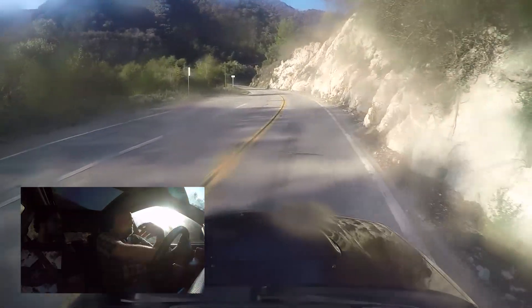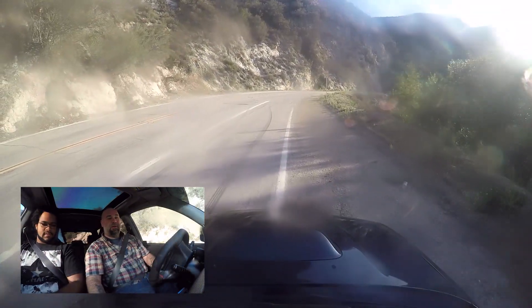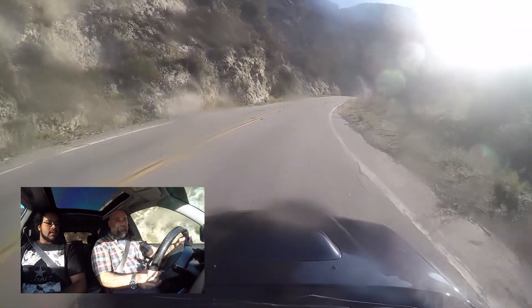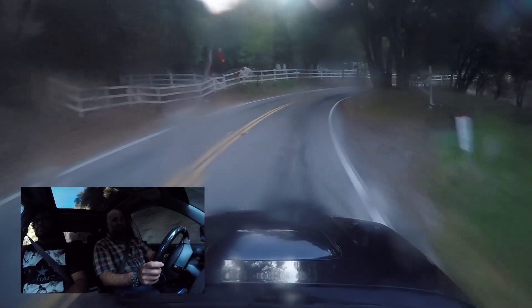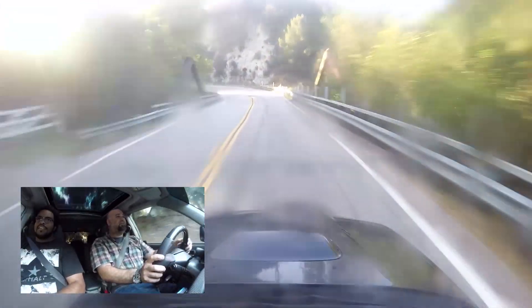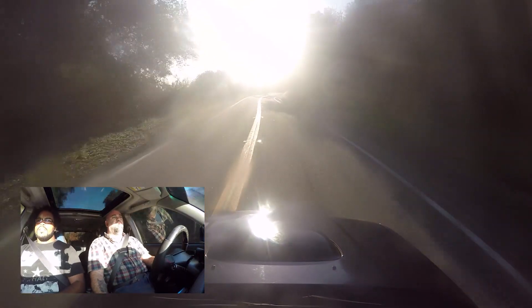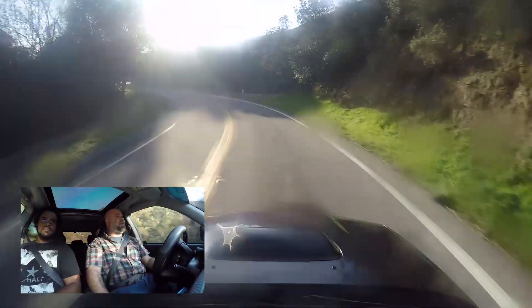Let's see how your turning radius is. Crap — is it bad? Not the worst I've seen. Let's clear out the windshield, it's a little humid in here. Uphill. So did you choose a Forester versus an Impreza for practicality? Pretty much — this is my second Forester. Before this I actually had a 4Runner — those are great, they handled pretty decently. Oh, there's your hesitation again — getting fuel cut for some reason. I wonder if that's altitude related, man. Sometimes people come up here and have issues with the altitude on their tunes.